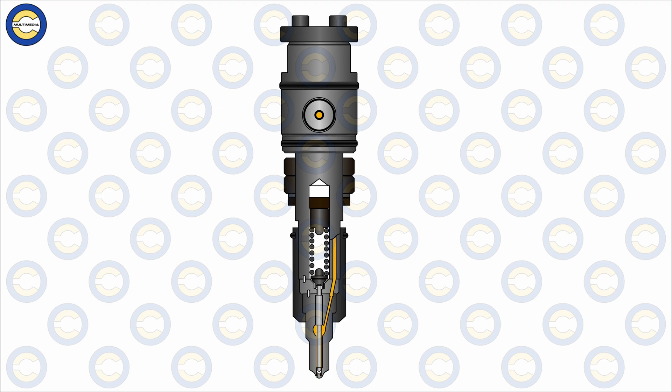The reseating takes place because of the spring force, which is a result of the pressure exerted by the tightening of the nut during assembly. Once the needle seats, it instantaneously stops injecting and avoids any further dribbling, meaning any untoward entry of fuel into the unit is stopped. This also helps us understand why the needle and the nozzle must always be replaced as a pair and there should never be any cross usage — such as an old needle with a new nozzle or vice versa.